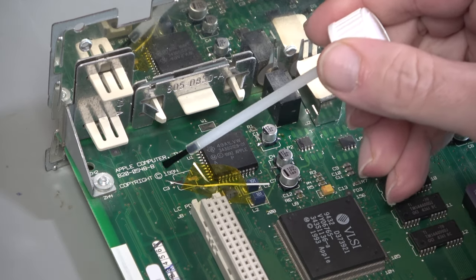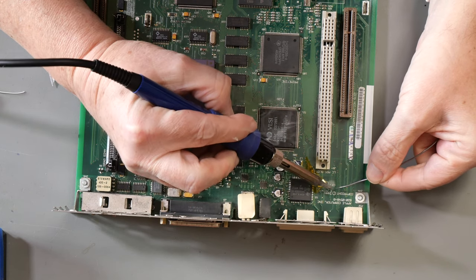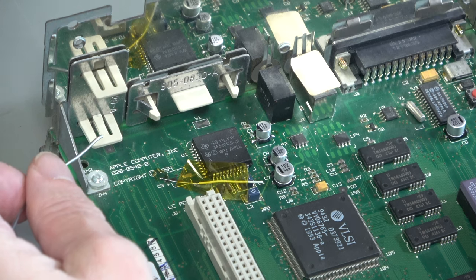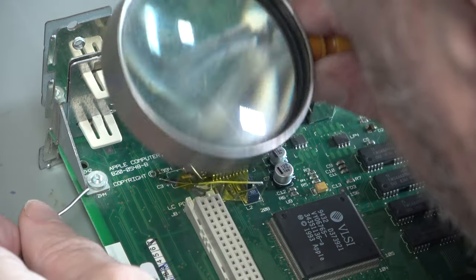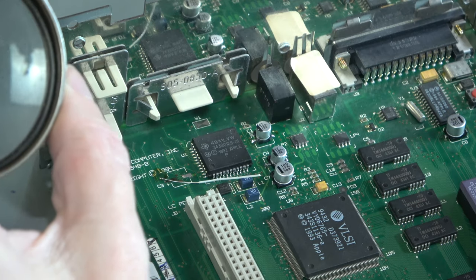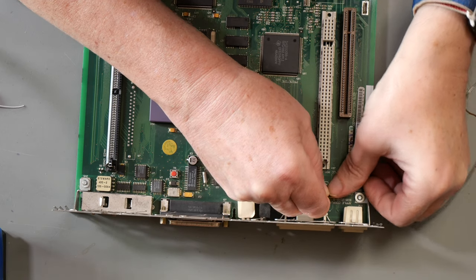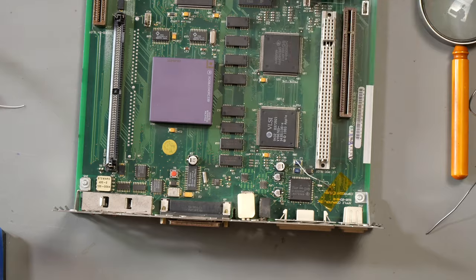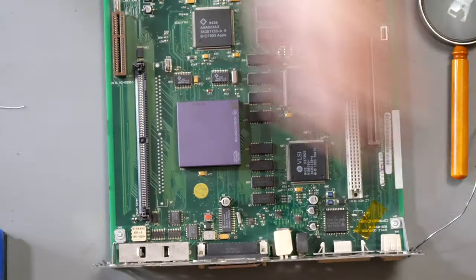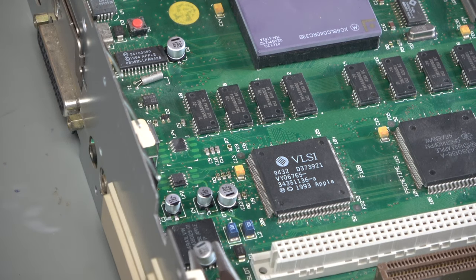Let's add a little flux. I think that's attached. Take the wire, take the tape off and see if it wants to... Yeah, that seems to be attached. I'll put the tape over that side, which will make sure that it is secured like that, so it's not going to go anywhere when we solder it. And then... And once again, tin the pad. Now this is going to be awkward, so...